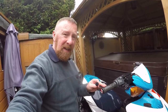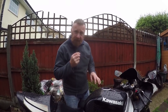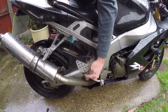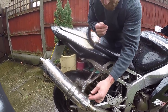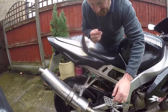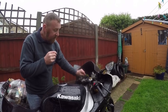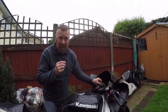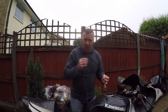Maintenance spray is the key. On these big bikes — if they're not sprayed up properly the cables are going to jam. This one's corroded and needs changing. Spray maintenance spray in all the little gaps, and spray some in where your key goes — that really will help — and any other locks on the bike.